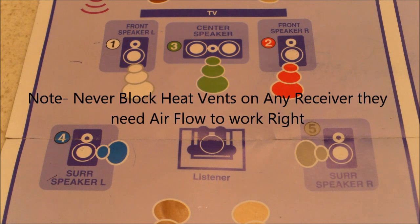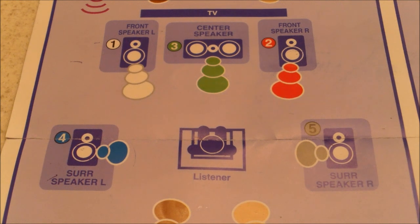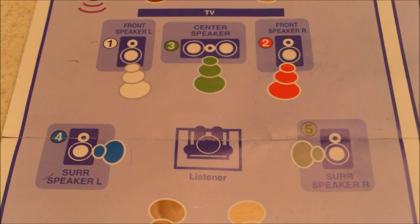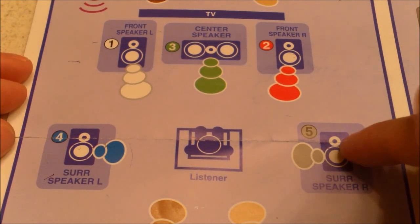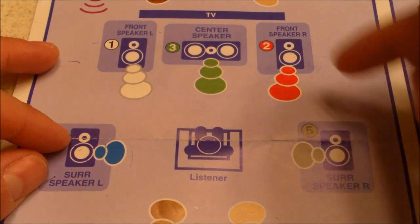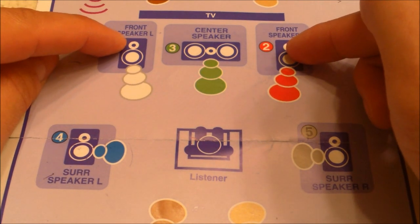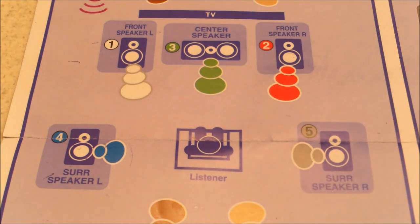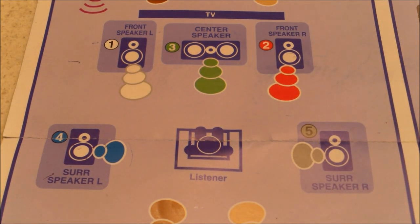But this system I'm talking about is under $500. So if you're just hooking up a traditional receiver, check out this video. Hooking up a 5.1 system would look like this: surround right and surround left speakers go on the side of the couch. Your front right and front left speakers go on the right and left of the TV. The center speaker goes right below the TV. Some techs recommend placing speakers at ear level, height-wise, so you get sound waves going directly into your ear.